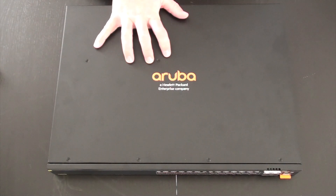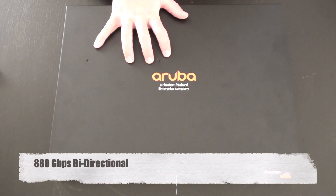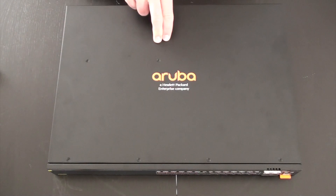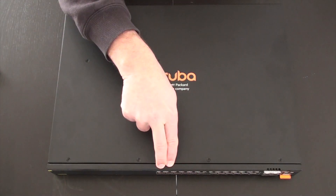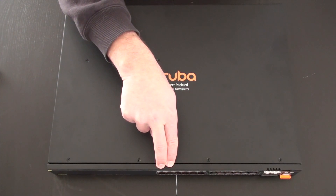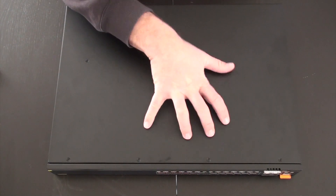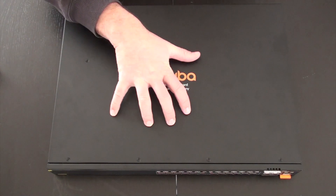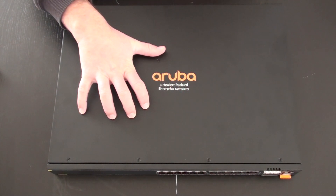The performance of all the switches is the same: 880 gigabits per second bi-directional, meaning 440 ingress and 440 gigabits per second egress. I think that's more than enough performance for high-end access, aggregation for enterprises, and core for small-medium businesses.